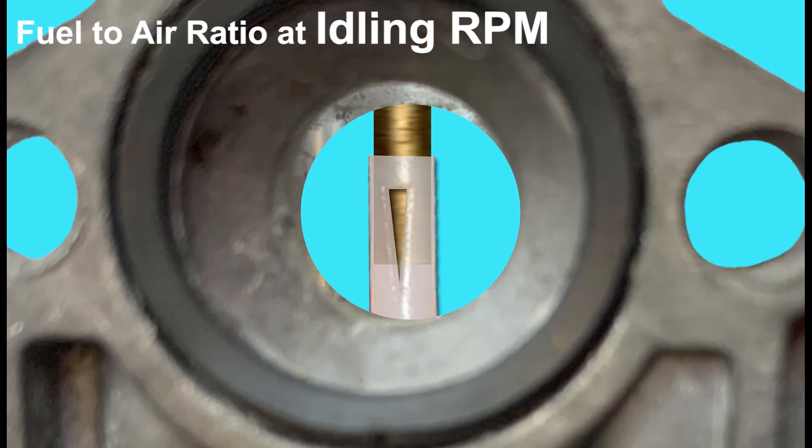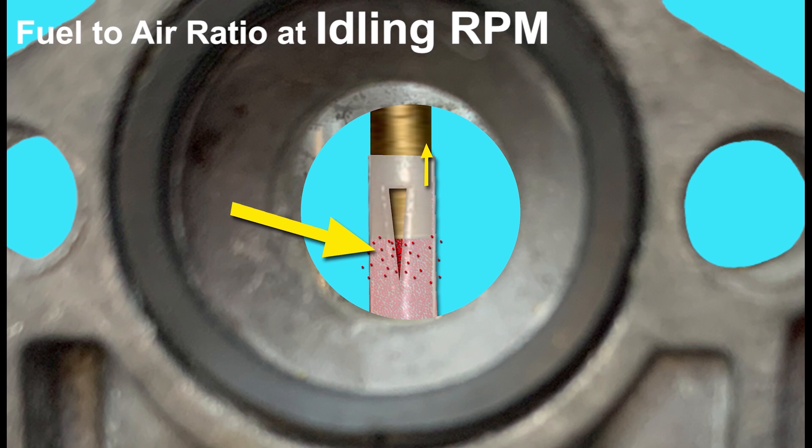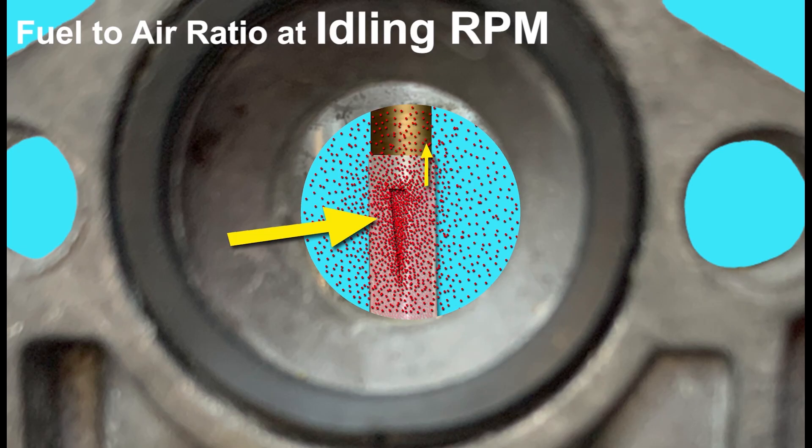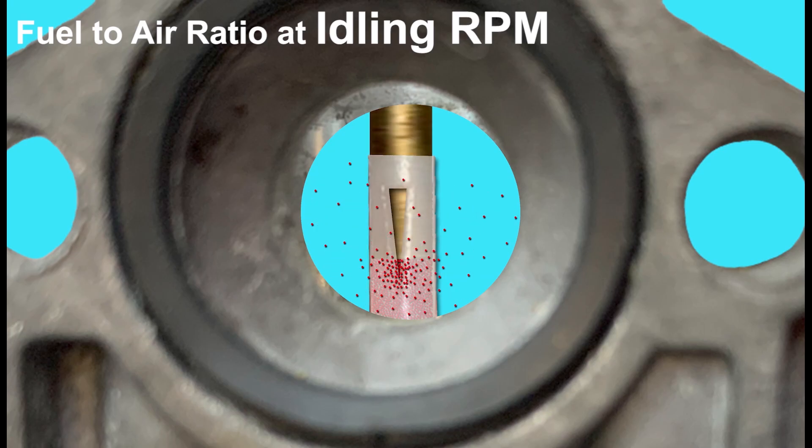Within the carburetor, when the needle screw is fitted in place, the needle can move up and down, thus opening and closing this gap. During the carburetor's normal functioning, fuel is brought up the main jet. At the moment the needle is low and closing off the gap. But if the needle were to raise slightly, opening up some of that gap, it would let some of that fuel out into the venturi of the carburetor and to the engine. As the needle raises we get an increasing volume of fuel out from the gap, and as we lower the needle we restrict fuel so there's less available for the engine.